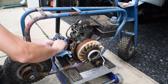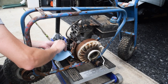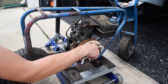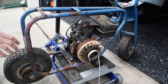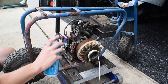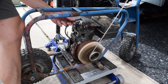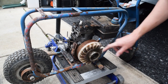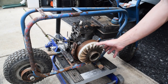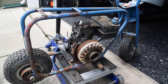The plug looks new. The valves look like garbage. Let's see if it even has oil in it — it has oil, okay, good enough for me. It's going to be wide open at the throttle since there's nothing to control it, but I'll just give it a little spritz of starting fluid. I think it's going to have no spark, so I'm not really worried about it, but we're going to find out. Yeah, there's nothing going on. I can't do what I do with a Briggs where I just put a more modern coil on it that has the electronic pickup. In this case the points are the only option, and I have a bunch of parts for them, but I just don't like dealing with them — so on the shelf it goes.